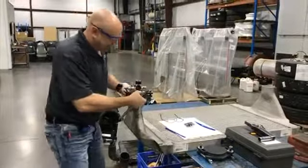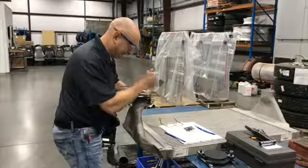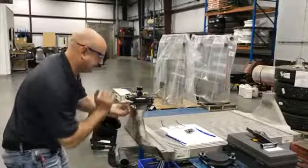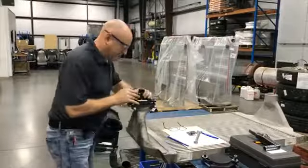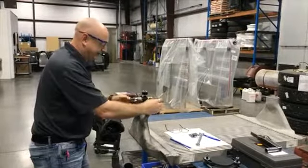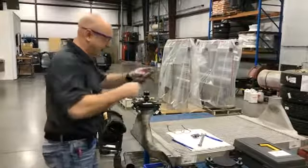So we're going to position this and tighten these bolts finger tight plus one turn — do not over-tighten these. I have tested several of them and it has never moved or shifted. They're tight and up against here. We are going to tighten a half turn, then another half turn. Center this cover over top of it, screw these down evenly, and tighten these to five foot pounds or 60 inch pounds.